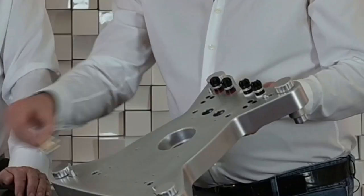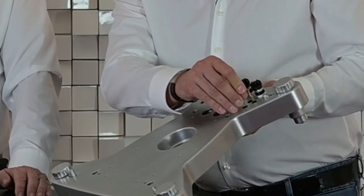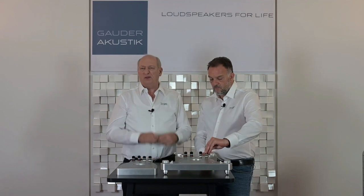Another remarkable thing on both the small foot and the big foot is the sockets for the jumpers. We invented this room equalization system over the years because our speakers are used in many different rooms — the geometries, sizes, and volumes are totally different — and the speaker should play perfectly in each. We thought about an easy adjustment without any digital means, because digital processing introduces jitter, delay, and loss of dynamics. It is better to do it in the analog world.